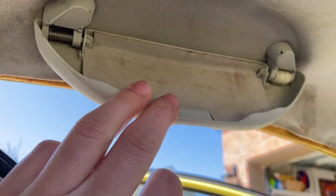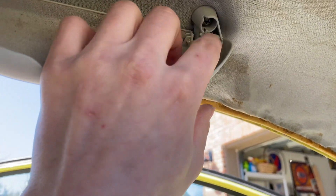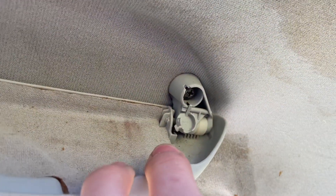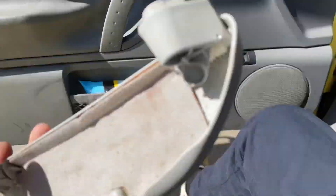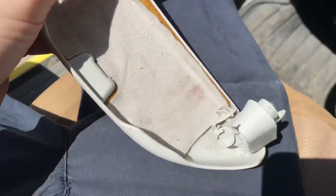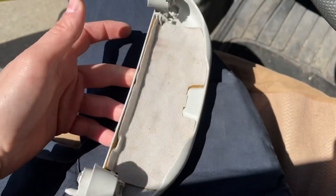For this little compartment thing right here, to get it off you want to pull this little lever down on each side to get a little flap, fold it down like that — very clean engineering. Then get those two screwdrivers in there; once you get those screws out it will just come right down once you tug on it a tiny bit. It's not in the best condition, so I'll probably be taking it out and just scrubbing it clean and making it completely plastic.